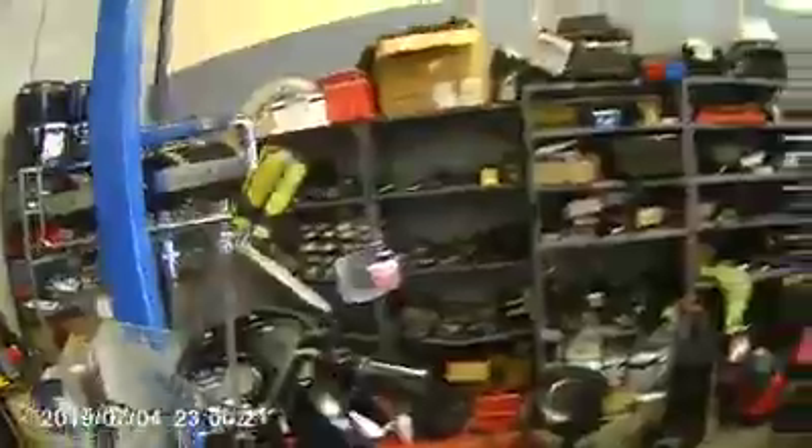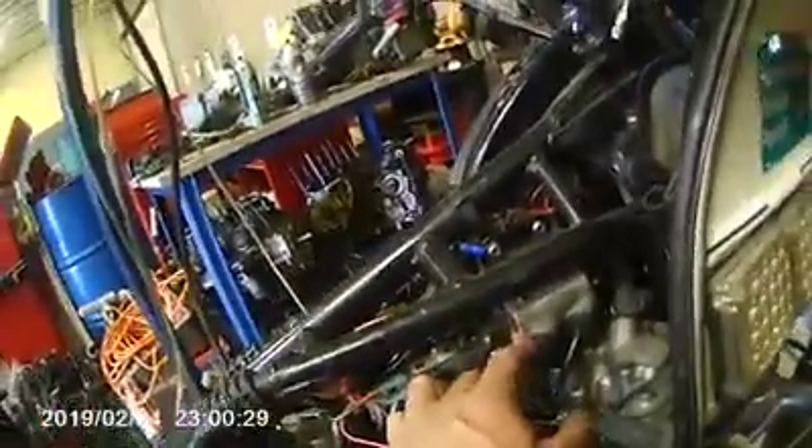This bike hasn't been started in a while — probably at least six months. The other good thing about doing this video is it lets me show you the other modifications we've done. All the bikes have Dyna coils — a really good modification that gives you a nice fat spark with a lot of voltage. We also have the air suction system removed on all bikes; we just run a connecting hose between them, since it doesn't really do much for the motor and makes it a lot harder to get the valve cover on and off. We also knock out the plugs in the carburetor so we can adjust them. This bike also has an extension on number four cylinder — it was burning some oil, and the extender keeps the amount of oil that gets to the spark plug to a minimum.